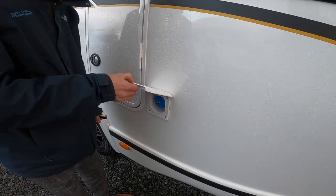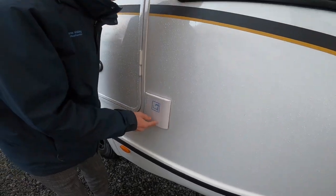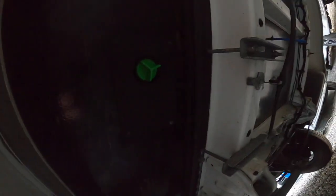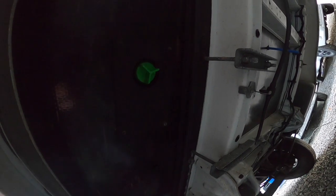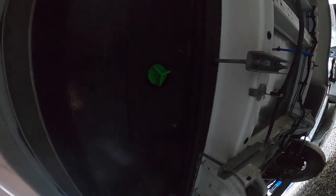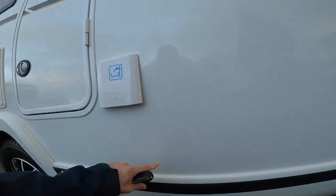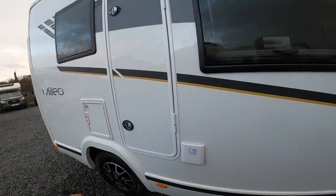The water level can't be seen on the main control panel. If you want to drain it off, you have to get underneath the vehicle. You'll see a little green cap — you just twist the green cap off and the water will start flowing through the floor. That's how you drain it off if you're taking on contaminated water or draining it down for the season.